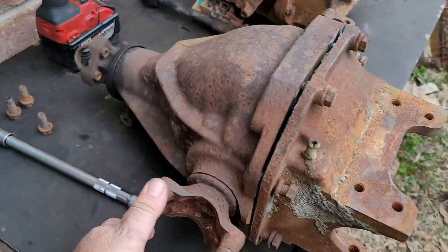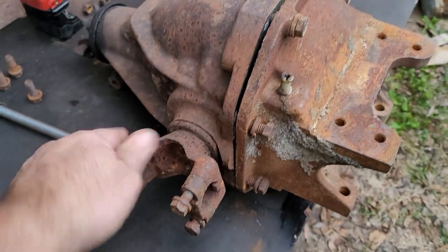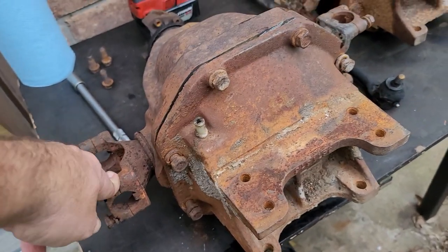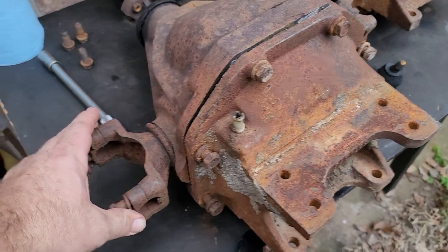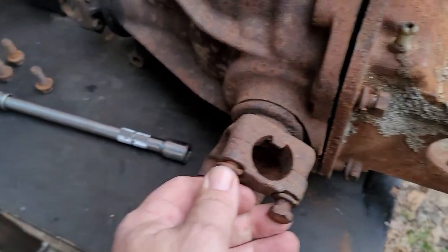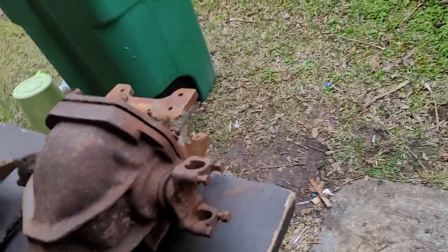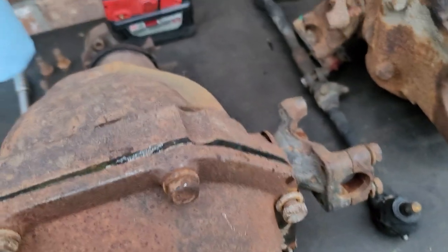This is the first iteration of independent rear suspension on Corvettes. Your input driveshaft comes in at the front, and the whole case is steel — no aluminum parts at all. It weighs close to 85 to 100 pounds. This differential is from a big block car — a 427 or 454 — and you can tell by these heavy-duty caps here. Small block cars just have the regular U-strap. These heavy-duty caps were built to handle the greater torque output of the 427 motors.